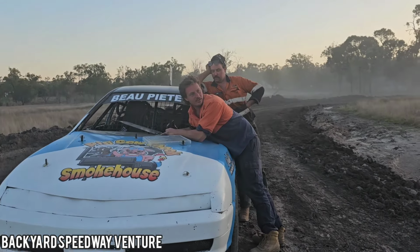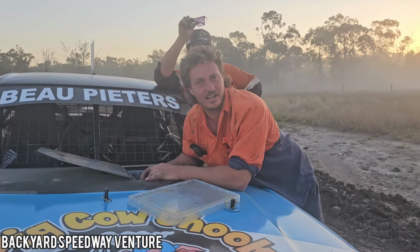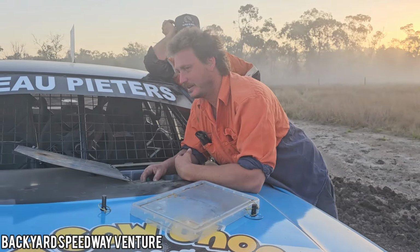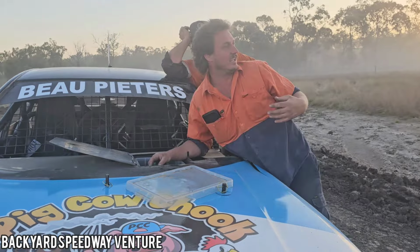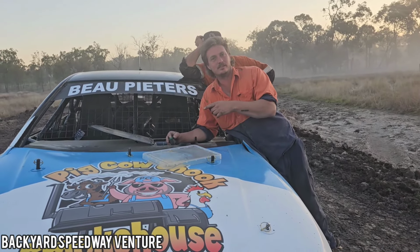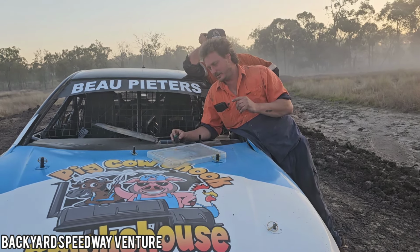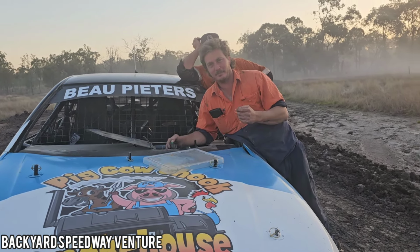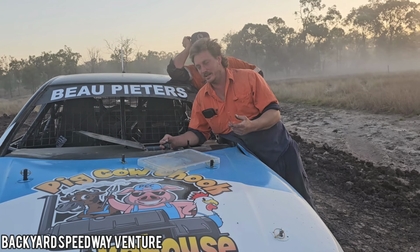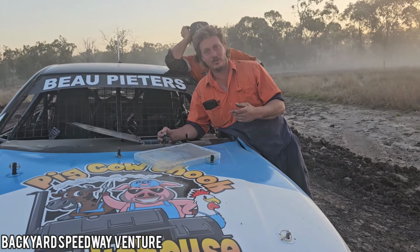Sounds like he lost that. What happened? I lost it because we hit that fucking sand patch like I did yesterday, and it came in the cab with us and I couldn't see, and then I went on the infield a bit and hit a big bump, and then it blew the injector fuse again. Same as yesterday. So I'm assuming it's from hitting a bump, which means there would be a wire, or it could be from fanging the fuck out of it and there's something going wrong.